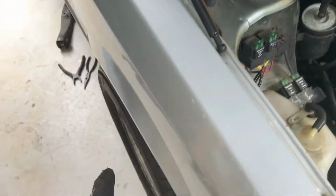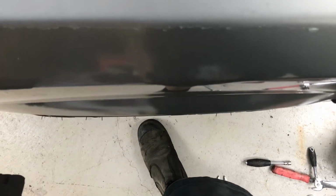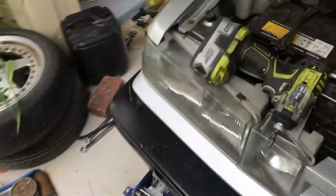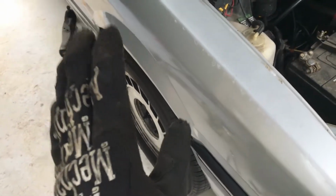So there was heaps of adjustment in that strut to knuckle joint, even without cambered bolts, and that is looking pretty tidy. So there we go, that's the wheel about dead straight there. That is so close. So the other side actually sits maybe even further out, to be honest. It's hard to tell. But I'll throw it on the jack just quickly and we can have a look when it's at compression. I might still have to raise the ride height just a couple of mil, but ooh, this is going to work and it's going to look great.